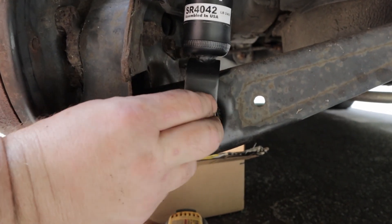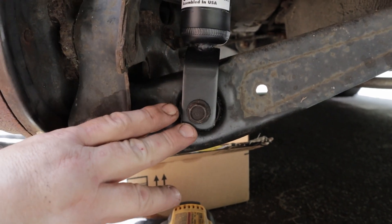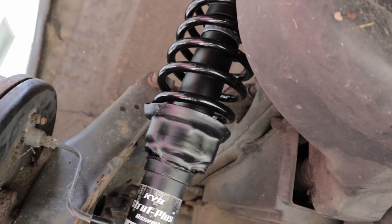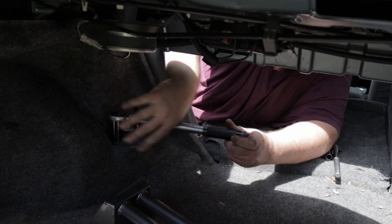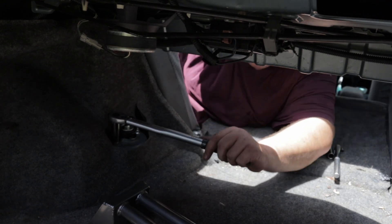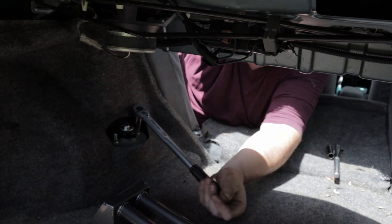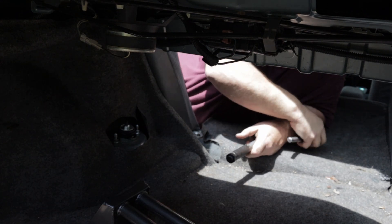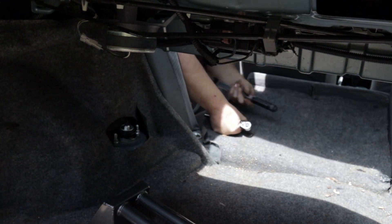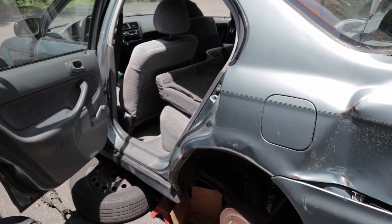Here's a better shot of the two bolts right here — one and two. Both of these are 40 pounds pressure. And then I'm going to go up here — these are supposed to be 36 pounds. I'm going to torque down the top bolts. There's 36, there's 36. That's it — that's one strut done. Well, there you have it. That's a quick video on how to put a strut on an old 2000 Civic. Thanks for watching.